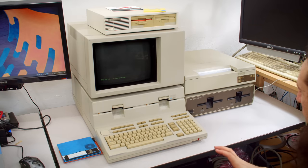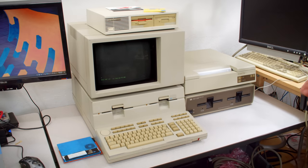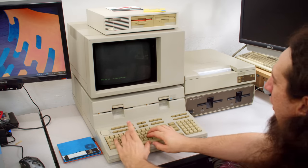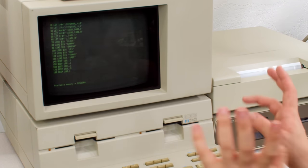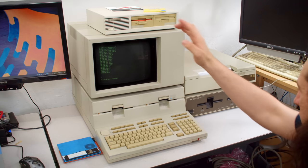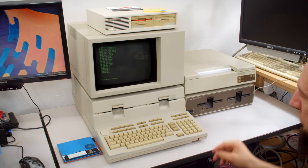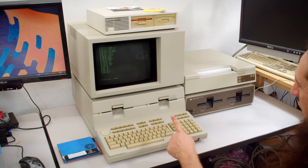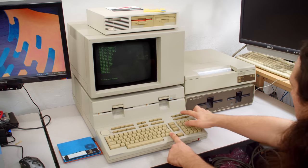But that's enough explanation of what's gonna go on here. Let's print some stuff. And it's very easy to do with the HP computers, which is just a lot of fun. So I've actually created an auto start file for this machine. I'm gonna go ahead and have it print to the display here, and we can now see all the lines of my startup script, and I can press one button to have this be printed, or at least this page. I'm pretty sure there's a different way to print out the whole project listing, but it's basically one page, so this will work fine. I'm gonna hold shift, and I'm gonna press dump alpha, which will just send it straight to the printer.